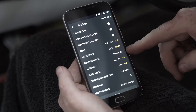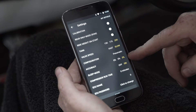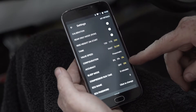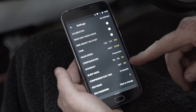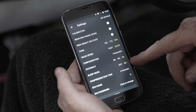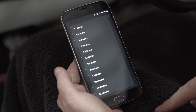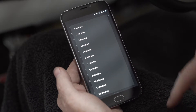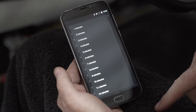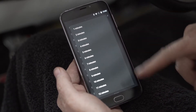We're on the pneumatic setting, which is height and pressure — the most accurate setting available. There's also a sleep mode so the vehicle will work when the car is turned off; it monitors battery voltage and will turn the system off once you go under 12 volts. You can also set your compressor run time — that's the amount of time the compressor will run after you turn the car off, up to 15 minutes.